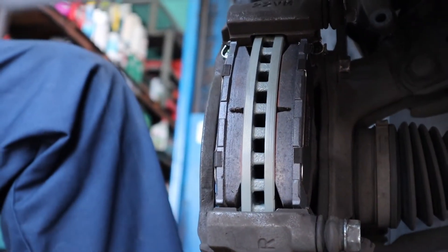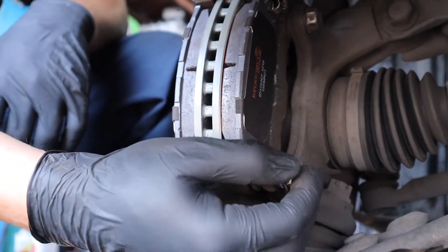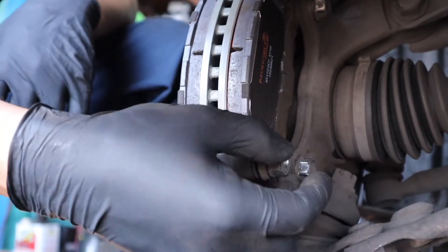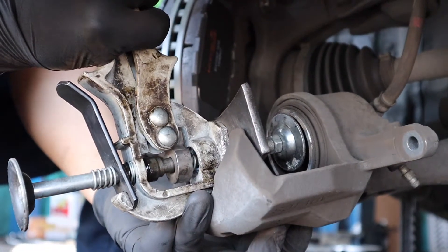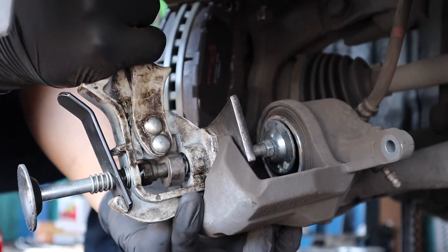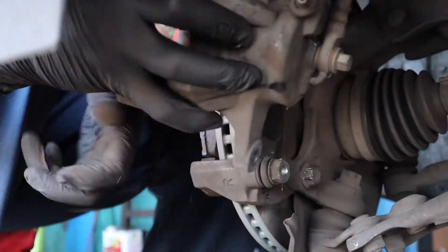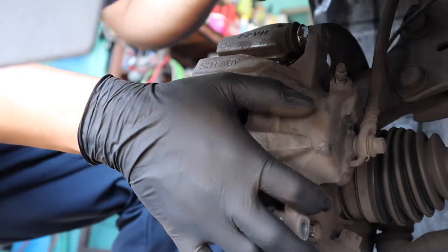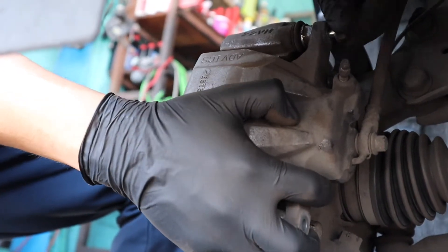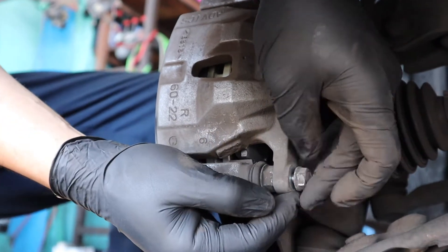Make sure that the guide pins right here are nice and loose — see how that is? Because if they're all stiff, you're not gonna be able to retract. You want to get that caliper all the way in — one side you can do it without opening it, and then the other side you will have to open it. Make sure it goes all the way down — that's why you get an easy installation. Get your 14mm bolts, make sure you guide them in by hand.